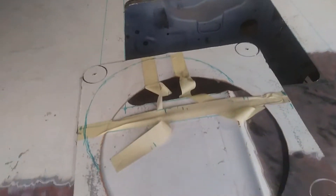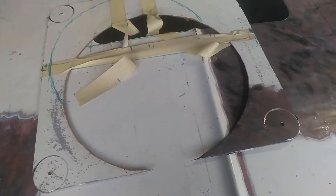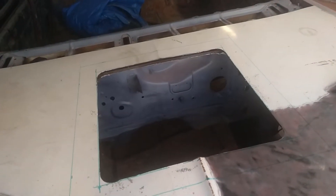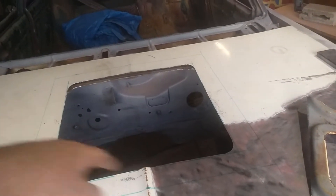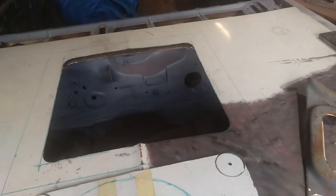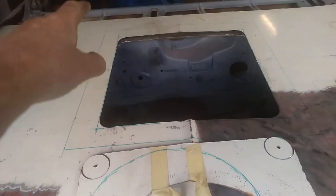Cold air intake on the Dodge. I think I fixed the hole-in-the-bonnet problem by not being in the right place — I just made a larger one. Basically I made it even on both sides of the center rib, as far forward as the original hole went. Now I'm just going to make up some bracing to go around the outside. I'm going to make a little rib or lip that goes all the way around, so when the motor's in I can make a base plate that seals for cold air. Then I'll get a bonnet scoop to go over it — if I can't find one that fits I'll just make a low-profile hemi-style scoop.